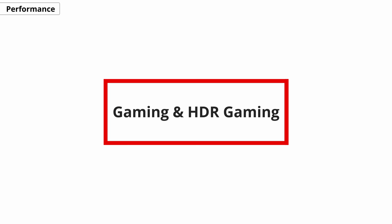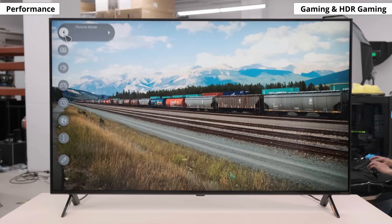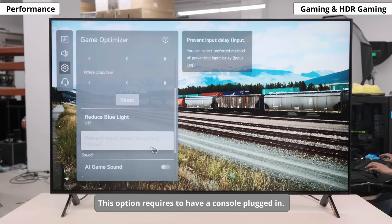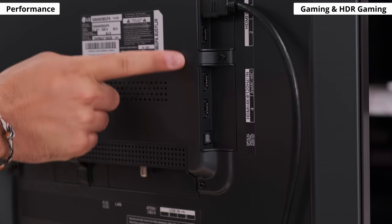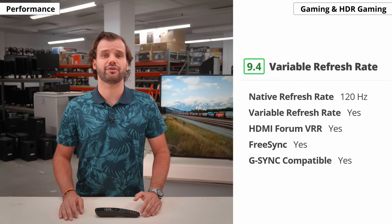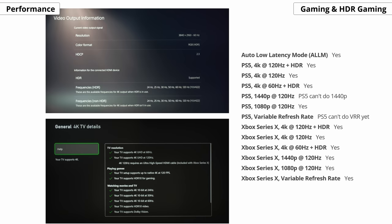Let's talk about gaming and gaming in HDR. The Nano 90 has great response times, and input lag is very good — even better than the 2020 model. There's also a new feature called Prevent Input Delay, which can reduce input latency by about 3ms at 60Hz but has no effect at 120Hz, because it plays 60Hz content at 120Hz by doubling every frame. There are two HDMI 2.1 ports which means it can display a 4K at 120Hz signal, making gaming feel smoother and more responsive. The Nano 90 supports variable refresh rate including HDMI Forum VRR, FreeSync, and G-Sync compatibility, and can do pretty much everything on the PS5 and Xbox Series X — though the PS5 itself doesn't have VRR support yet.